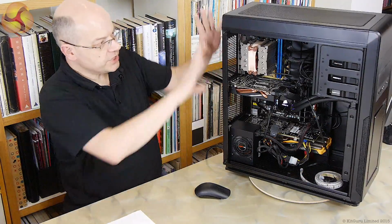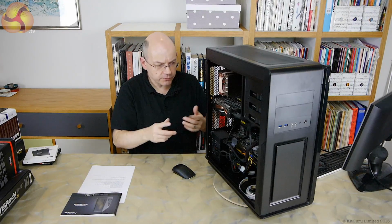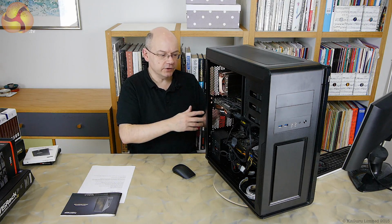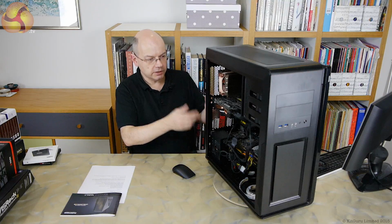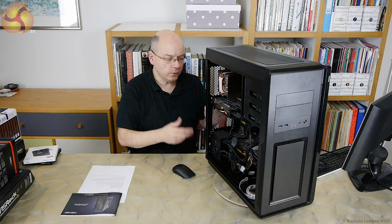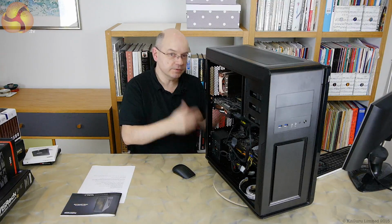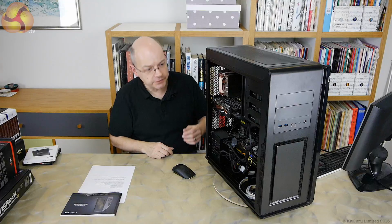Also, when you switch out the Mini ITX back panel, which you saw before, and it's also in the photos, the fan that comes as standard goes out the window. The standard 140mm fan goes away with the plate. You don't get a fan on the replacement Mini ITX panel. If you do wish to install a fan, it's only a 120, so you'd need to provide one of those. That would obviously go here. That is doable, it just seems unnecessary to me.